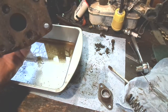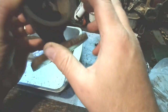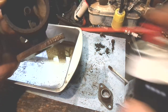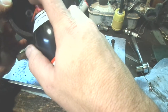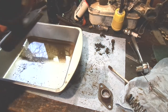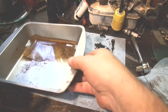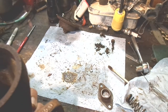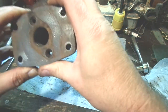I think I have seen these before where they didn't have that rubber o-ring in front. Normally you'll want to assemble your brake parts using brake fluid, but I don't have any in here and I don't feel like going back out to the garage. Since this thing's junk, we're just going to use what I have on hand.